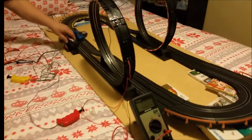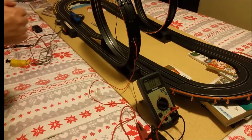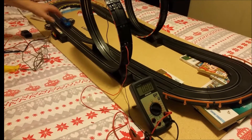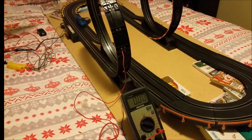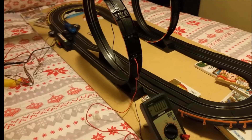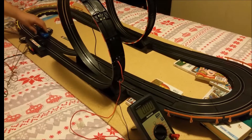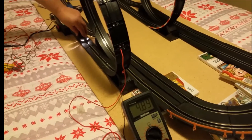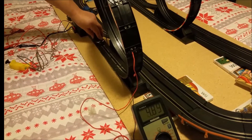With the meter I'm actually getting 5.2 volts. With brand new fresh batteries I'd be lucky to get 4.5 or 4.6 volts. What was happening is even with brand new batteries, with both cars under load the voltage drops. I can simulate that — you can see it dropped down to 4.9 volts, which is still way more than I would have gotten off the three C-size batteries.